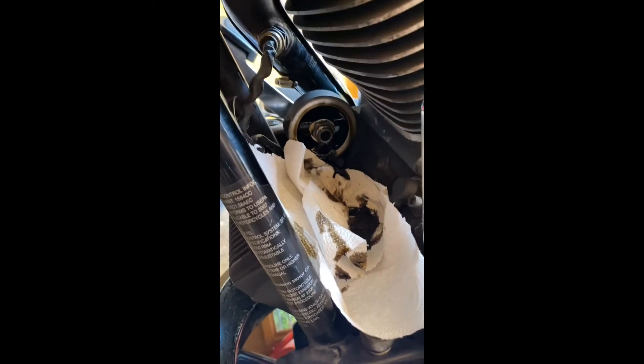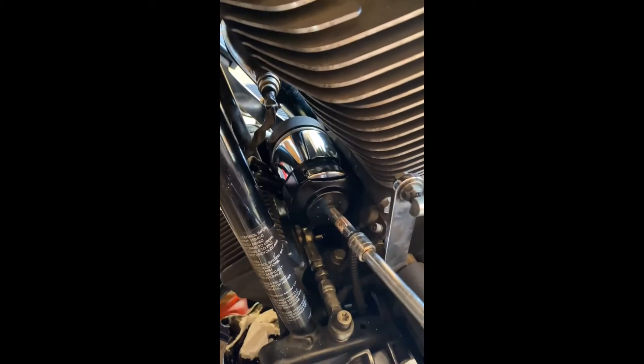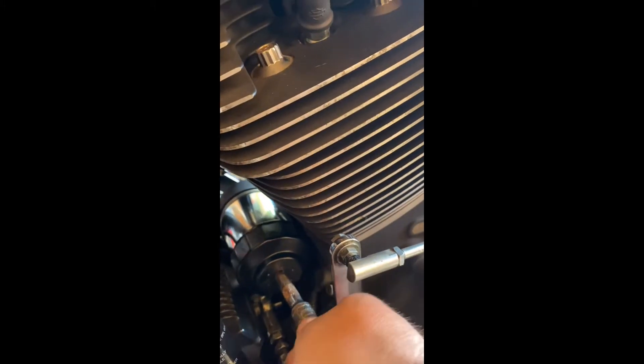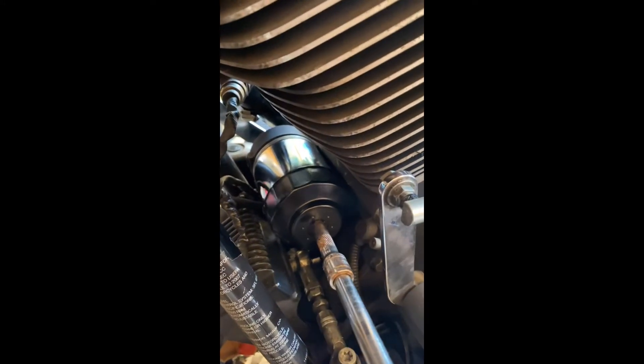I did let it drain as much as possible but yeah, there's still a bit of a mess. No doubt we'll do some cleaning up in a minute. To install the oil filter in place, I'll just tighten this nice and slowly — there's no need to go silly. I'm tightening this nice and gently right now because if you over-tighten it you'll struggle next time to get it off, so just nice and gentle.